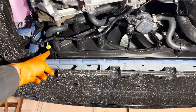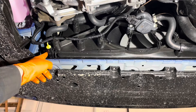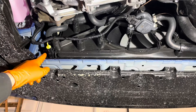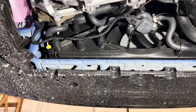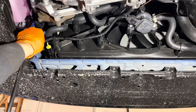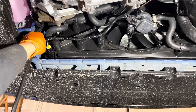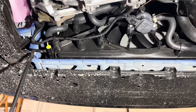The inverter coolant drain plug is located right there. It's a drain that points sideways, so you need to install a piece of hose on it to direct the coolant downwards. It's a 5/16-inch diameter. Sometimes you can get a thinner hose on it if it's pliable enough, but 5/16 is what fits perfectly on there. Then get the other end of it into a suitable drain container.